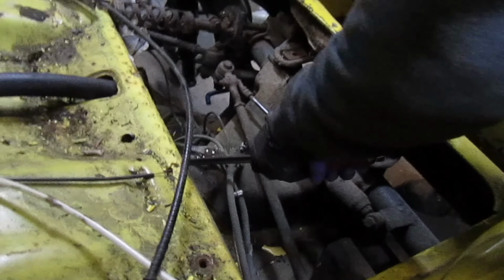All right guys, so I just started prying. We took all the bolts out, the interior ones included. See, the whole body is loose. So I got the floor jack with the block of wood underneath the front nose, and then I jacked it up a little bit. I jumped on the frame head here, and she came loose.